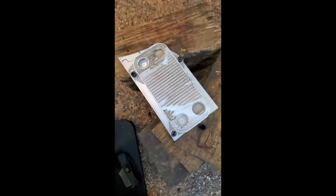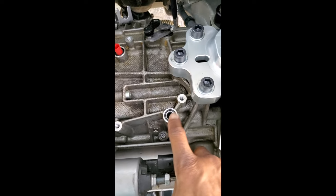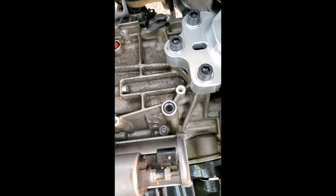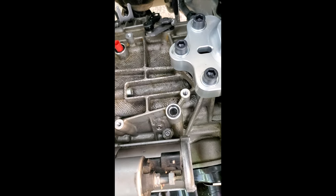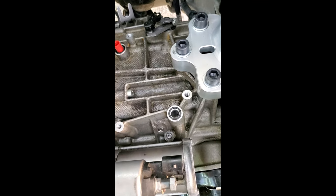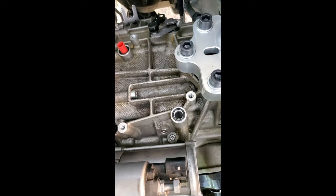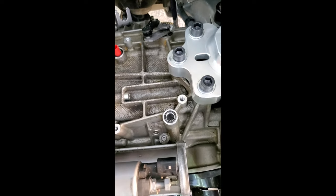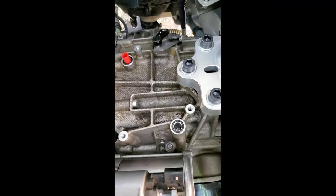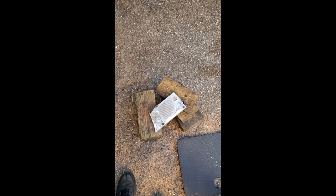Both holes are centered, and from this point I'll drill through and slowly step up my drill bits until I hit exactly the right diameter. I'll measure to make sure I get to it with the proper drill bit and don't go any bigger. I want nice flow with no restriction — the hole can't be too small, yet needs to allow proper flow. I still have to drill and tap it, so I'll step up slowly, and when I drill and tap for my fittings everything will fit perfectly so the fitting has the same inside diameter as the port.